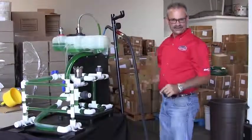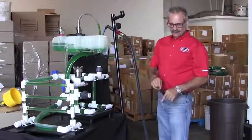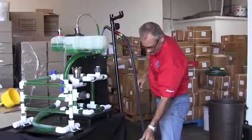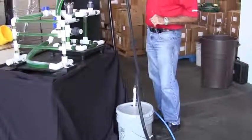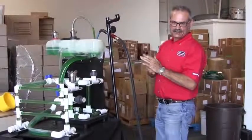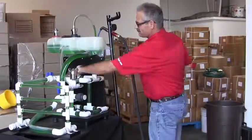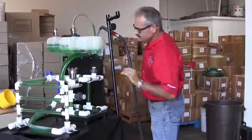This is a follow-up to the earlier demonstration. I wanted to make sure there's at least a few gallons of coolant in this bucket, because if we're going to be refilling the cooling system, we don't want to run out and start sucking air from the bottom of the bucket. That's why we have this rigid piece of pipe with a T on the bottom, which makes sure we're picking up from the bottom. We started with an almost empty cooling system and now it's largely filled, but there's very little water in the surge tank and I see evidence of air in the system in a number of places. Let's run it again.